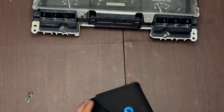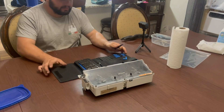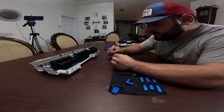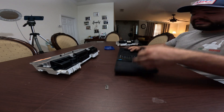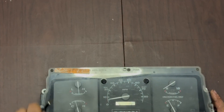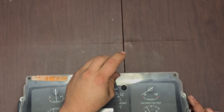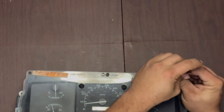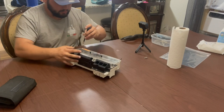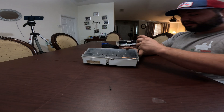The first thing you're going to want is a beautiful iFixit kit. I've had mine for a few years — it was the best $79 I've ever spent on a tool kit. Grab the tip labeled 5.5 — that's the size of the socket. We're going to remove all the external bolts to get access to the inside. You can use Torx bits too, but I always use the socket. Honestly, Torx bits always seem to strip on me no matter what size I use.